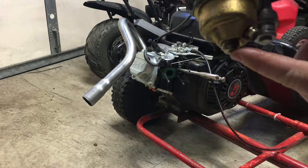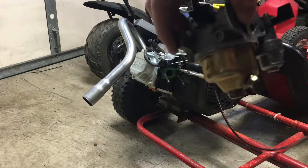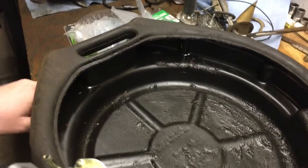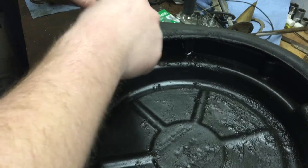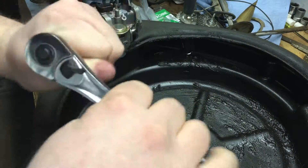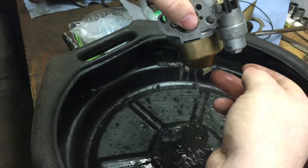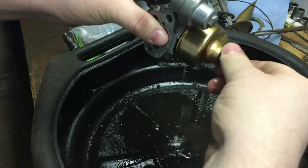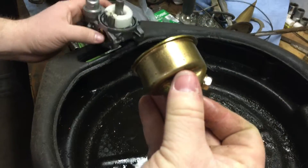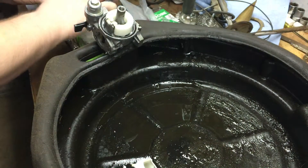You can take this bolt off or take this screw out to drain it, but once you take that bolt off you can tip it to the side and the gas will just come out right here so it doesn't get all over you. I'm going to do this into a little oil can. Get your 10mm, get it in loosening mode, and crack that baby — once the bowl starts to spin, just tip her up and now I only got minimal gas on my fingers. Get all the gas out and make sure this is clean.